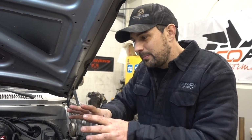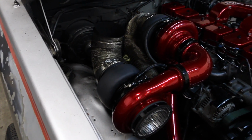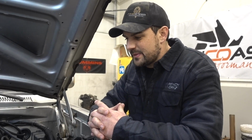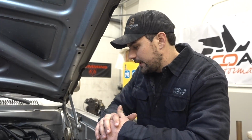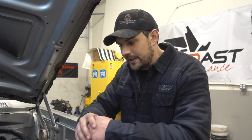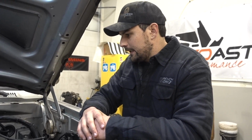Mikey G actually set us up with the injectors that are in this thing. We might be changing them up a little bit, but they are 5x25s, which are on the bigger side. But good thing our turbos take care of cleaning up all that fuel. So I believe that's pretty much it fuel-wise. Specifically for the overflow valve, we're using a Keating Machine check ball in there. Our man Abe from Muldoon's actually helped us out with the linkage stuff. He helped out a lot.